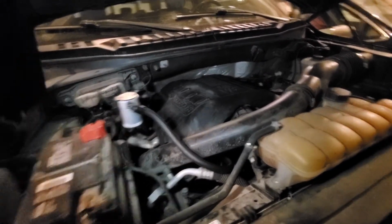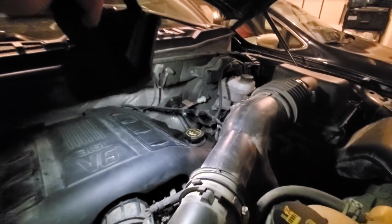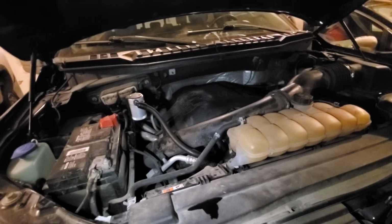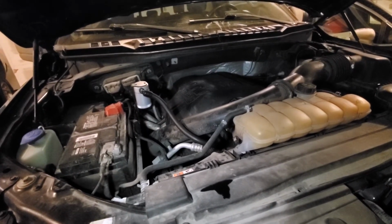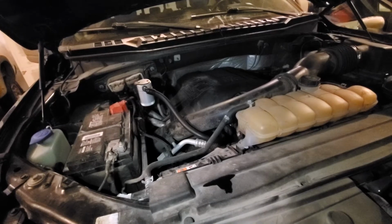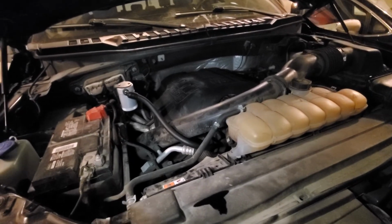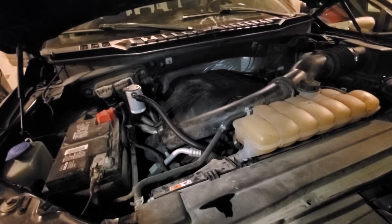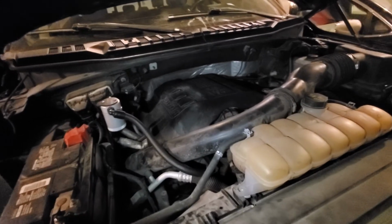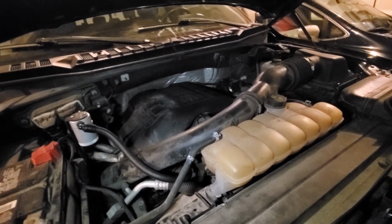All right, so I've put the catch can back on there. I have put the cap back on top so oil doesn't come shooting out the top end of the bay. I've got the appropriate amount. I've checked it on the dipstick, and then I'm going to put all the stuff back on underneath. I just haven't done that yet. Once everything is put back together, I'm going to back the truck out of the garage and let it run for 10 to 15 minutes and make sure everything is tight and I don't have any leaks. Once I've observed that I have no leaks, then I'll bring it back in the garage and put all those pieces on underneath. Because if I did have a leak, I may not see it because the underbody paneling would catch the little drips of oil and I wouldn't notice it. Then I'd have a problem later on down the line. So that's my recommendation to you guys. Make sure your stuff is good to go by doing it that way.